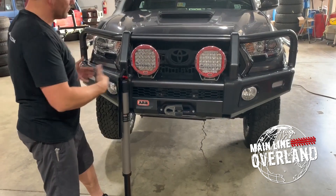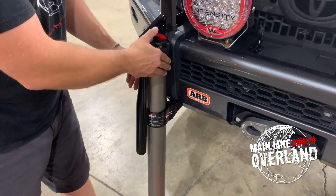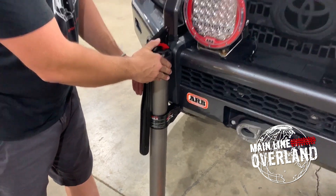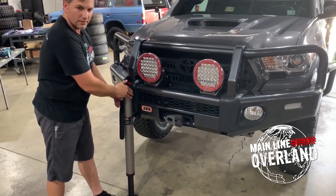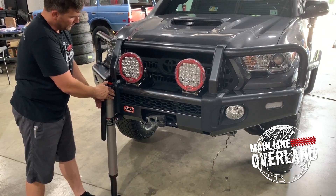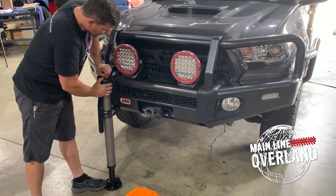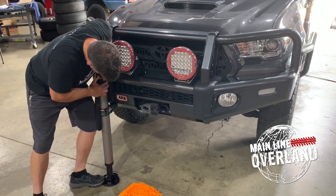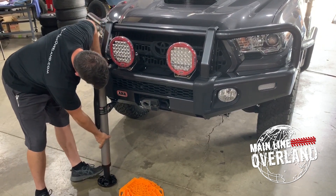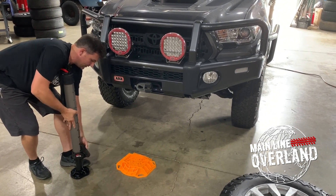Let's say I'm going to lower this — I've got my wheel change done. We have this red lever here, it's super simple and very intuitive. I haven't read the directions, just learning as I go. I can make quick adjustments — maybe put the tire lugs in contact so I can tighten down the wheel before torquing. Then if I want to quickly descend, I can lower it really quickly and get that completely out. This does take a little bit of effort to lower — you have to put some body behind it because of the hydraulic motion to get it low enough to pull it out. But that didn't take much effort at all. I've got it out and can lower it down to the away position.